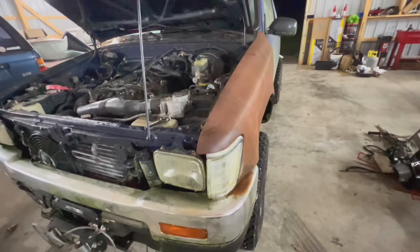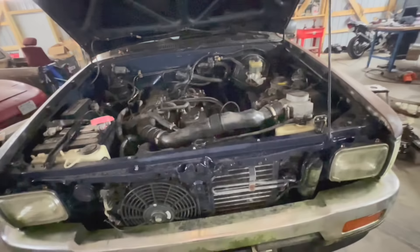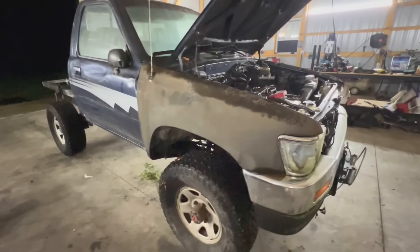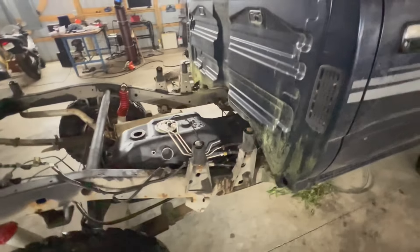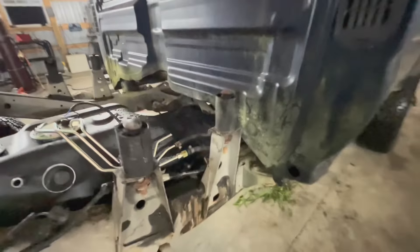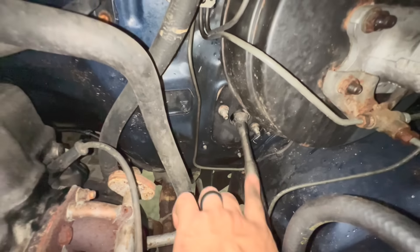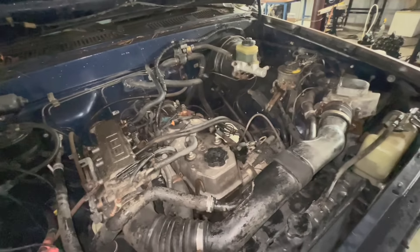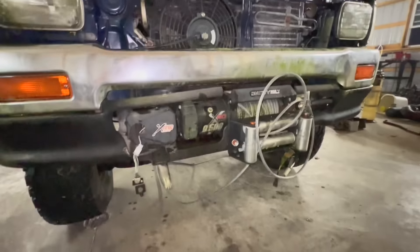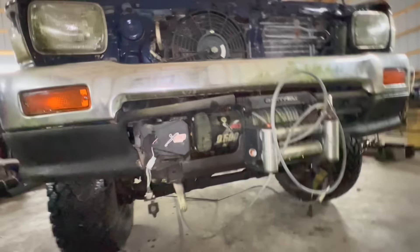The fenders were never resprayed when I changed them, so they'll have to get completely stripped down to bare metal or replaced - and they're also dented from wheeling it in the woods, so I'll probably just grab new ones. This truck also has a body lift - I think it's a three-inch. I'm not fully sold on keeping it. It'd be a lot of work to remove because you'd have to shorten the steering column - I welded an extension in there to extend it - and you'd have to extend the shift linkages. I never liked the way the shift boots fit after doing the lift. That's really the only reason to take it back out, because I don't mind the looks and it did give me clearance to mount the winch under the front bumper.